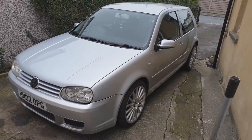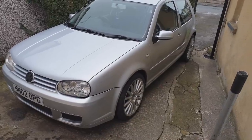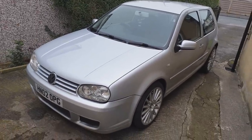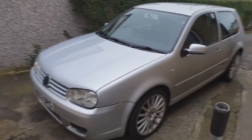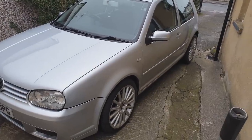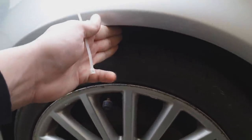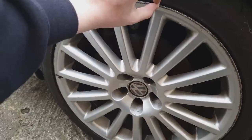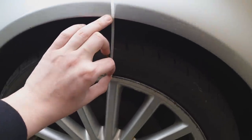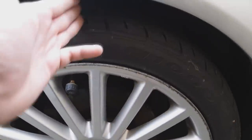I'm going to start by cracking off all the wheel nuts and loosening all four corners, then do the fronts first, get it in the air, then do the rears after — do the fronts, drop it, pull the car forward, then do the rears. But first I need to measure the gap in the arches. I don't have a tape measure, so my solution is the finger method — three fingers between the tyre and the arch. Then I'm going to measure a cable tie from the top of the rim and cut it off there, so after fitting I can measure the new gap and compare.